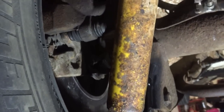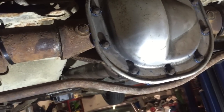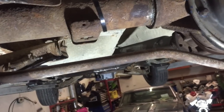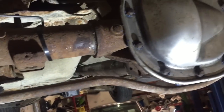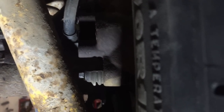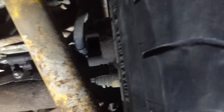When I got this diff I got everything down to the lug nuts — I didn't want to buy lug nuts, I didn't want to buy anything. All that stuff is free when you buy the diff for $118, then I got about $26-28 back with the core. I also returned the original driveshaft since I got the Aerostar one, and they charged me a $10 core on the intercooler so I just returned the bottom six inches of the intercooler and they didn't seem to care. The caliper bolt is probably a quarter inch away from the shock, but that part doesn't move so you don't have to worry about it — the rest has adequate clearance.